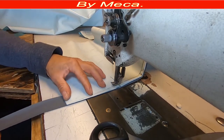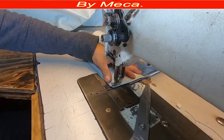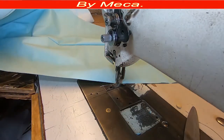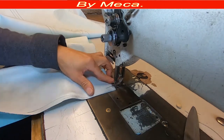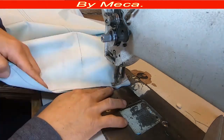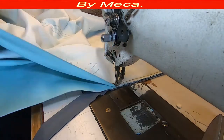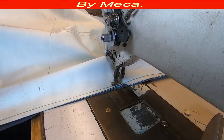I'm going to end the listing right there — three fingers away from that mark — same thing, three fingers — then I cut it. I now have two pieces together with that listing. I'm going to put these pieces together with the next one — same thing, three fingers away — and put the listing under. Some upholsterers put the listing on top, but it doesn't matter if you go on top or on the bottom. The most important thing is that the two edges from the headliner material and the edge of the listing all line up, and you sew exactly on top of the line.